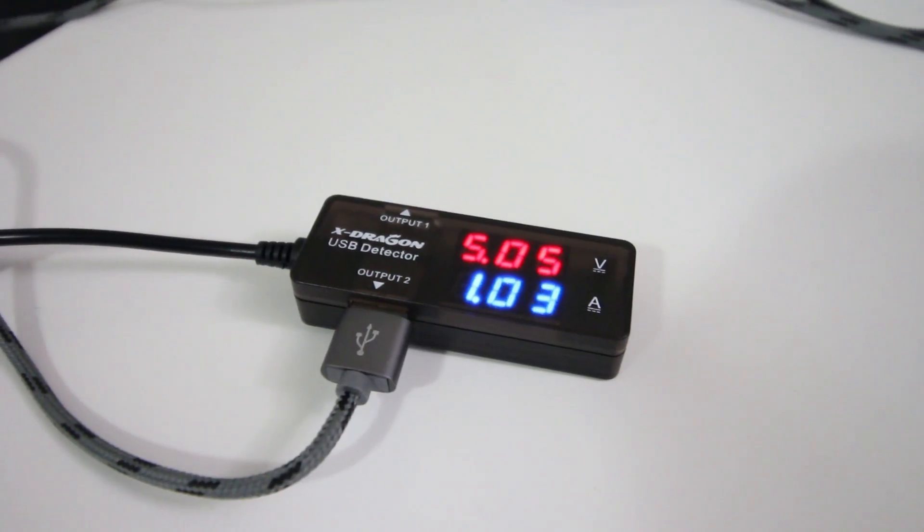Right now I'm using a CPU-only coin, which is XMR — the Monero coin if you're familiar with it. I know they have GPU miners for it, but the GPU is not as efficient as the CPU for this coin. In comparison, on a Raspberry Pi mining the same coin it does about 10 hashes per second; this guy does 18, and the Tinker Board does 13 — so that's the comparison. I've done the same mining on my GPD Win — that little laptop I reviewed, which is Intel Atom — and it only does about 13 hashes per second. Even at full load I'm only drawing about 1 amp of power on 5 volts, which is very impressive.